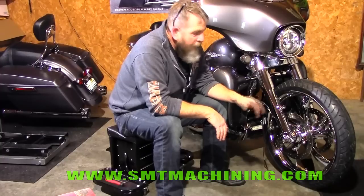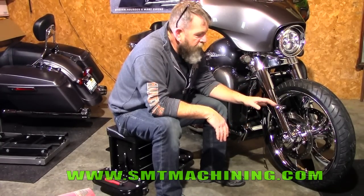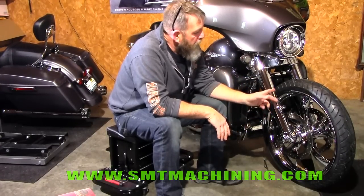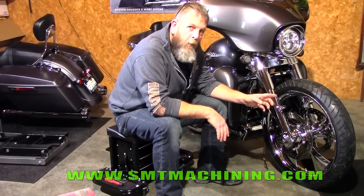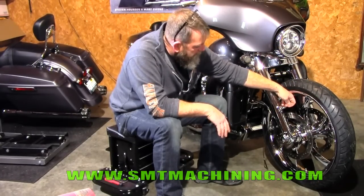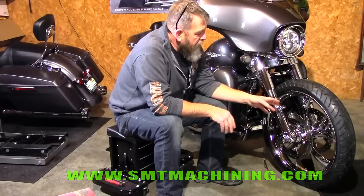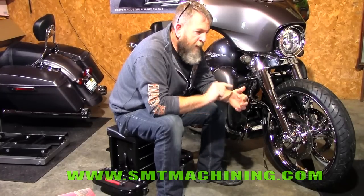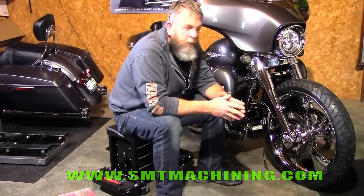Right now we're just going to get it installed — we'll bring the camera down and have a look at it. The wheel is now fully installed and as you can see I've got the fender off. I told you at the beginning of the video that I was going to have to get the fender risers for this size tire, and they're on order — should be here in a couple of days and we'll do a video on that. With the stock fender on a 2014 and the Metzler 120/70-21 tire, it's a little too tall to allow me to put the fender on — I was about a quarter inch off on my bolt hole. You'll definitely need fender risers if you go with that tire on a 21-inch wheel. On the 2014 and up, the nuts are welded to the back of the fender so you can't just bore the fender out and tilt it. On 2013 and down I think you could do that, but the 2014 and up — definitely not an option.